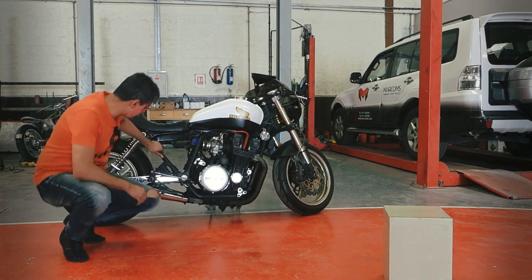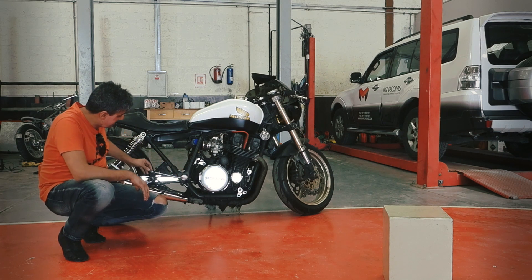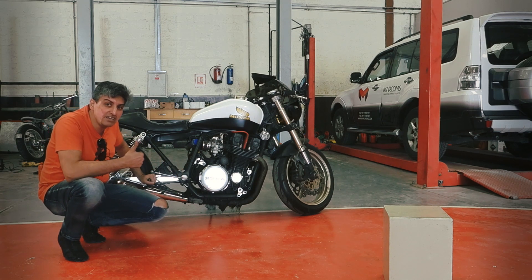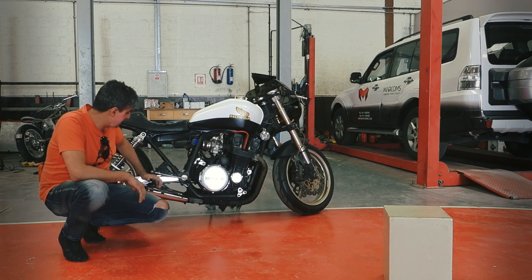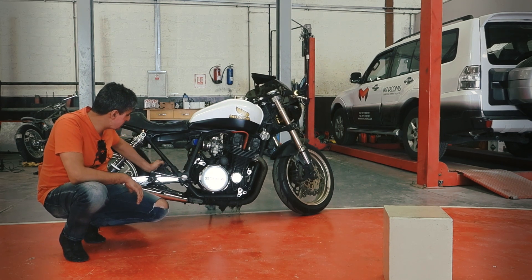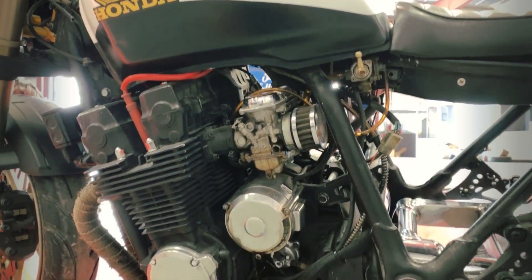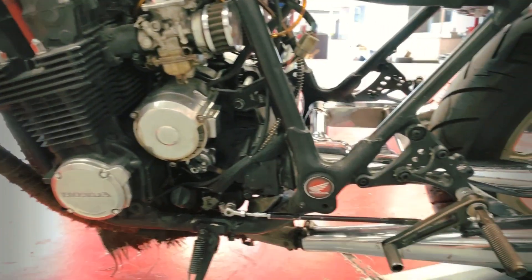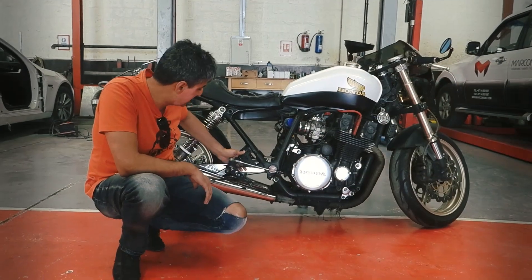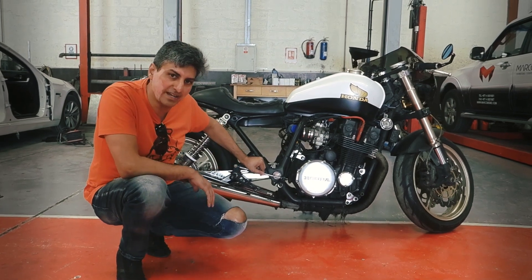So we had to do something about the foot position. You will see the foot peg has come back by nearly one foot. It was not easy to find a rear set in the first place because this position was not designed for a rear set — it was for the passenger foot peg. Nobody would do a rear set for this size, so we fabricated something out of billet metal and managed to fix the gear, but not the brake.